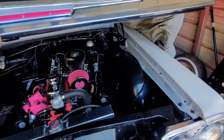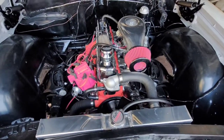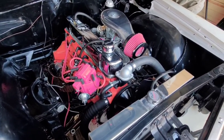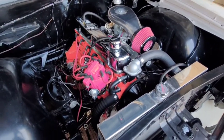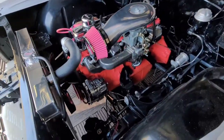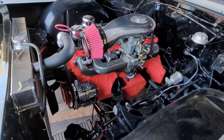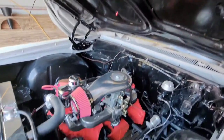There she is. Kept the little straight six 230, had it rebuilt, put a mild cam in it, a bigger distributor, and I had it go from a single barrel to a two-barrel carburetor. So it was too high — it was hitting my hood and I wasn't cutting my hood.